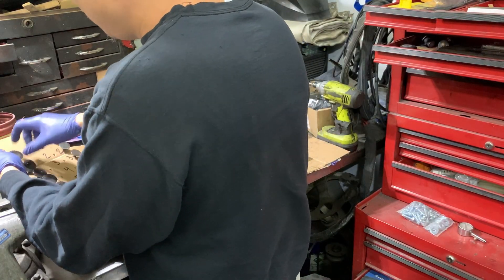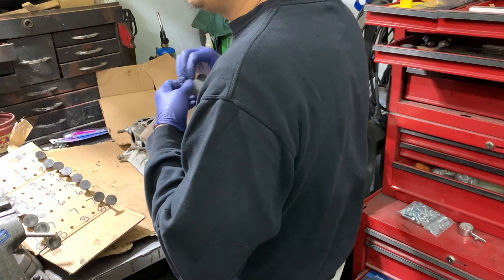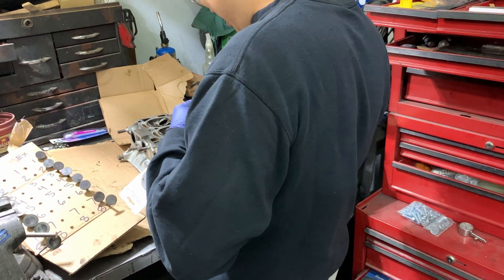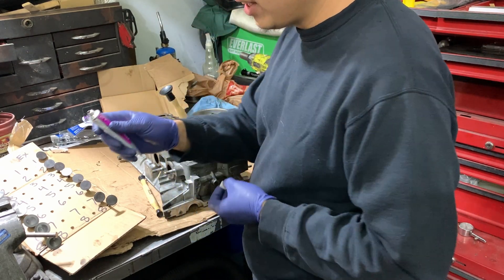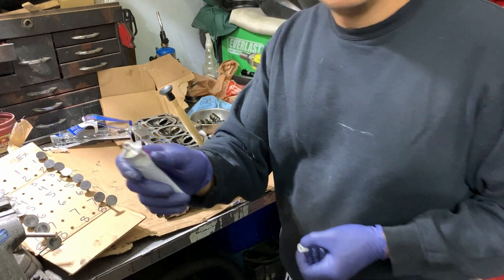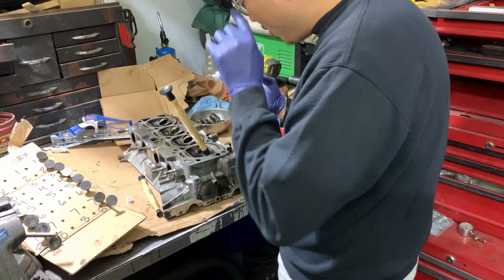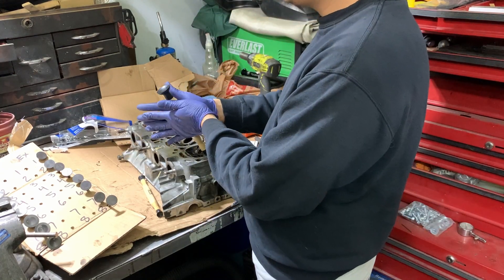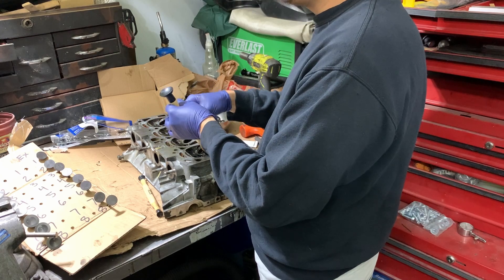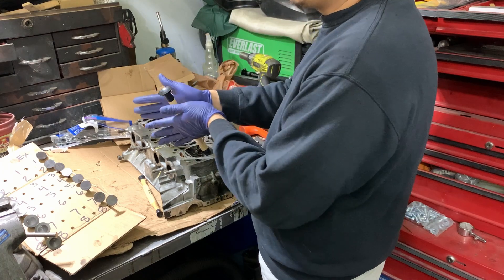Intake — we'll do intake one. Lifetime warranty? I don't know. We're going to get our valve lapping compound — gritty grease, you see it's all metallic. So what I'm going to do is just drop a little right there. You hear it? Yeah, sounds gritty. So what it's doing — it's sanding down the seat so it fits the valve perfectly. Make sense?